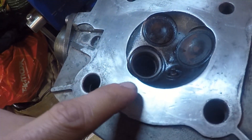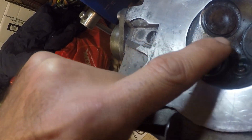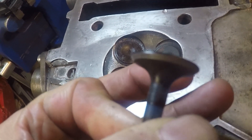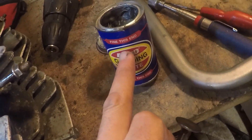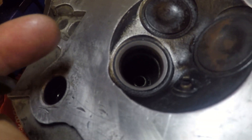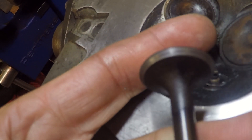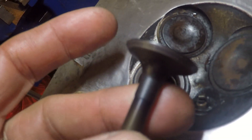So I've done the coarse and I seem to have a nice clearly defined silver ring there - the edge of the valve looks good to me. I'm going to now repeat the process using the fine end of the tin. Right, I've finished regrinding that - the seat to my eye looks absolutely perfect now. The valve similarly has a nice shiny edge all the way around the underside.